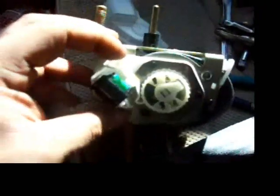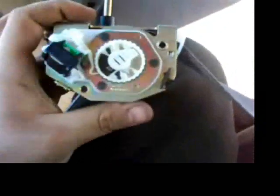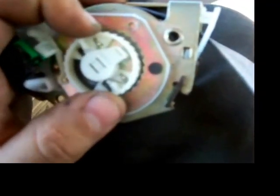And that little piece of plastic, if this is even the one, yeah, it is, for this side, goes in there. And if you can see, except it's a little bit too bright, way too bright, here we go. Ooh, hold on. There is, if you see this gear here, there's another gear like this that's metal inside. And if this piece here, this ball moves out of place down inside here, this will go against that so the seatbelt can wind back in. Let me pull it out a bit. The seatbelt will be able to wind back in, but it cannot come back out.